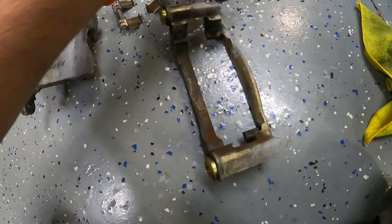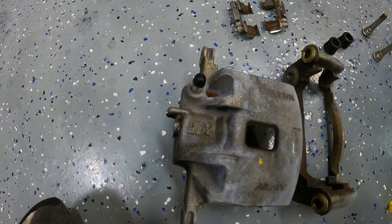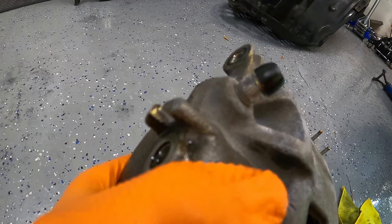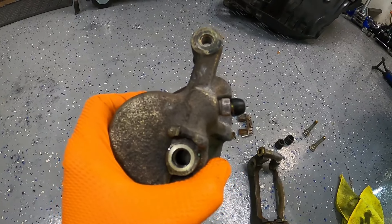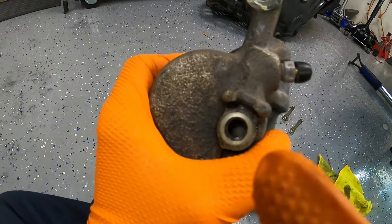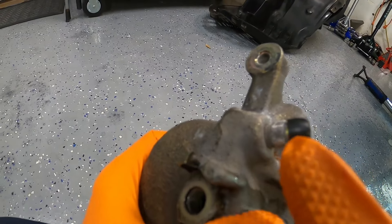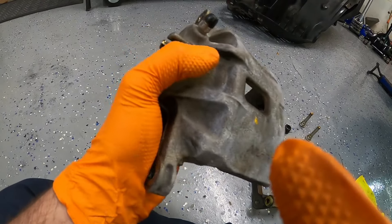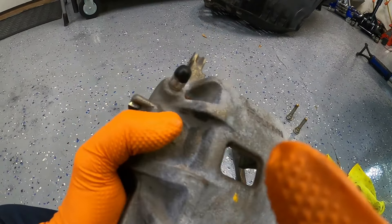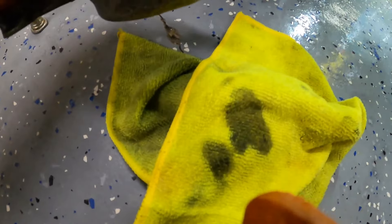I need to take off this little cap — this is actually a brand new OEM cap on the bleeder valve. My bleeder valve isn't in terrible condition but it is very slightly rounded off. I like my stuff super fresh, so when I order the rebuild kit from Honda I'm also going to order a new bleeder valve. I'm going to leave the old one on there to keep that hole plugged while I sand and clean up the caliper, then put the new bleeder valve on when I'm ready to reinstall.